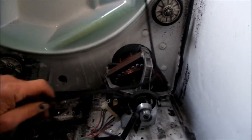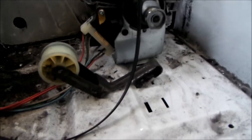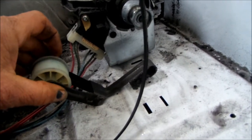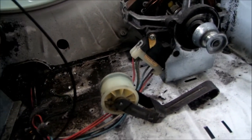Basically, of course, it's gonna go around the barrel. When you put the barrel in, then the belt will of course go around the barrel, and you can see the mark on the barrel. And so basically what you want to do is set your idler like this. Right like that, and that hole. Then the belt goes with the ribs facing the drum or the barrel.